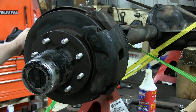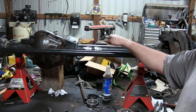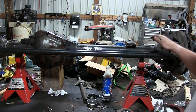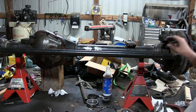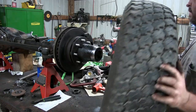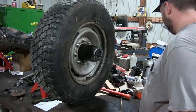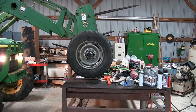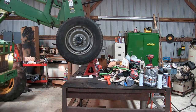Now we're ready for wheels and let's work on this tie rod. I upgraded to this heavy duty tie rod from Off-Road Design — it's inch and a half by 3/8 wall, super beefy. All I did was adjust it to the length of my old one and drop it in. I've got it in nice and loose right now — I don't want to tighten everything down until I get it underneath the truck and make sure everything looks good before giving it the final torque. Let's put our wheels on and get this thing off the table finally. Thanks everybody for watching — if you like this video please hit the thumbs up, subscribe if you want more, and leave questions or comments down below.